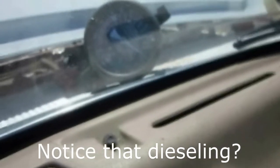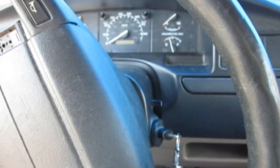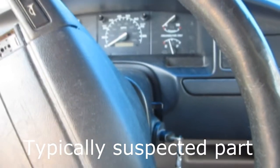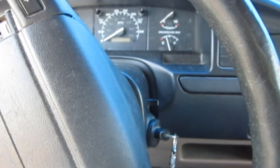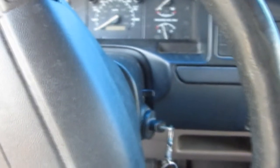The pressure indicating there looks like it's about 10, and that's what they're calling for. You can see that pressure is still there, so this hookup actually works. Now let's go to the front — I'm going to switch over to the front tank. Same thing: run position, halfway to the floor and back, then crank it. The fuel filter has been replaced and run for the evening plus some hours, and I got two conk-outs with it on both tanks.